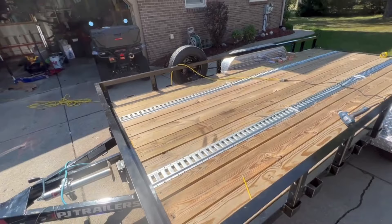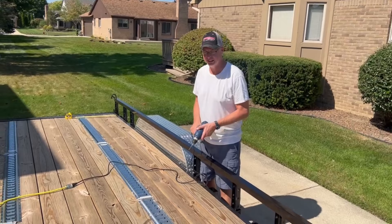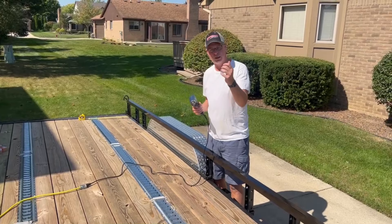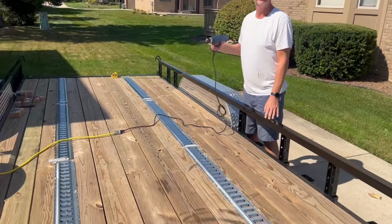So we just put four inch-and-a-half lag bolts through these. There are six pieces in all, so we put four per piece. Now we're drilling a bunch of holes in the e-track system — we're going to drill well over 100 holes right now, drilling into the framing. We're going to put 3-inch bolts through with pretty wide washers and then a nut underneath, with a hex bolt on top. We're going to tighten them all down with the drill while someone is underneath holding. So we'll have lag bolts, through-bolts, and bolts going into the framing — about half an hour's worth of drilling right now.